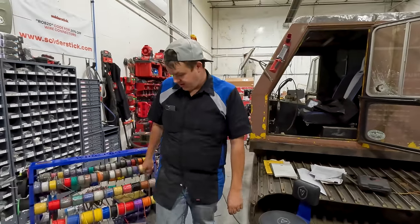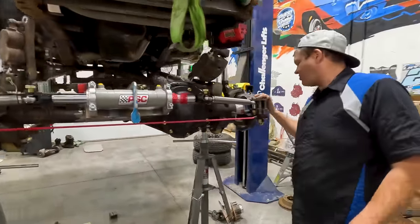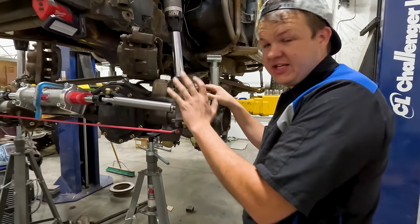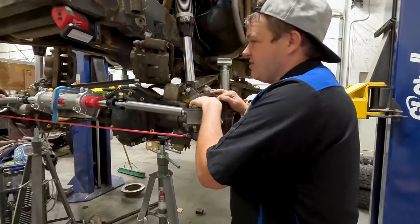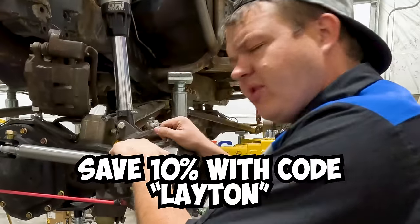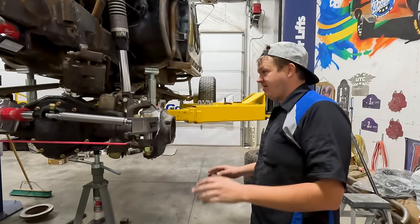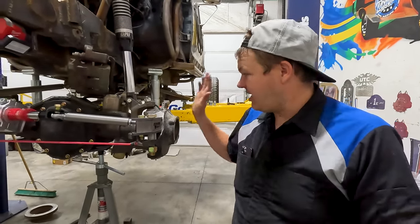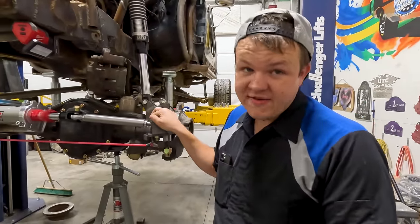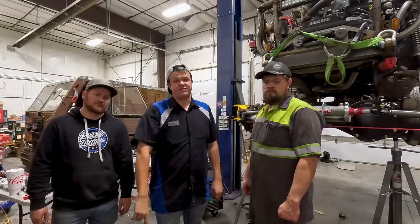So we've got the PSC steering, full hydro, all mocked up — it's in place. We used our Barnes Four Wheel Drive Dana 60 high steer kit on a Dana 50 with slight modifications. Barnes Four Wheel Drive does awesome stuff — make sure you click the link in the description, save yourself some money using our code, tell them Robbie sent you. We've got this to the point where all we've got to do now is weld it all up and it will be done. Getting ready for King of the Hammers. We're tired and we'll be back another day. We appreciate you — if you enjoyed this video, go check out this one.